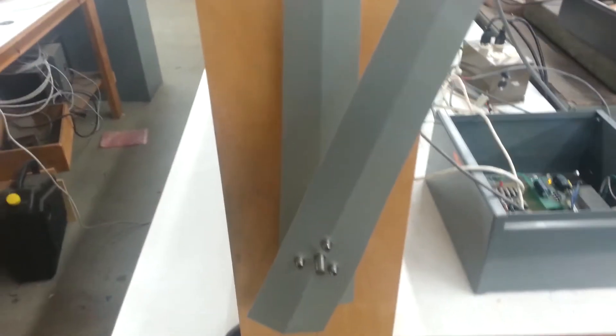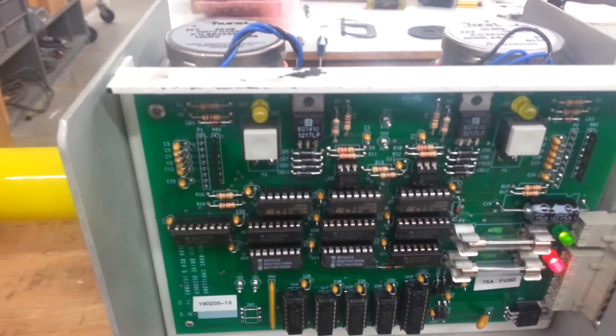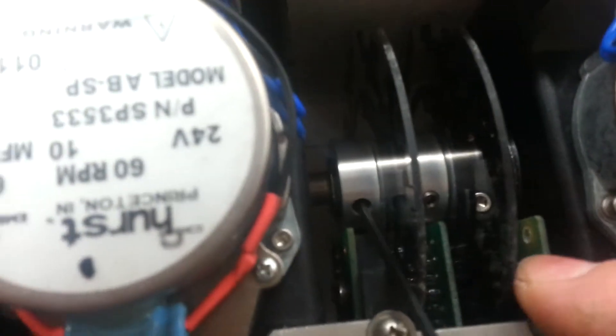One of them I placed out of adjustment — the minute hand — and I sent the clock to noon. The motors have stopped. And as you can see, the lights are out indicating that data and wheel positions are matching, so they're correct. But the hands aren't matching because they're out of adjustment. The minute hand is right here, and this is approximately five minutes out of alignment. On these wheels, there are little black tick marks, and you can use the edge of the plastic housing for your measurement.